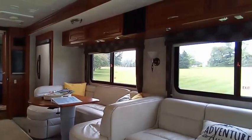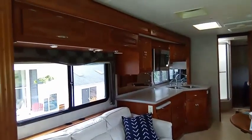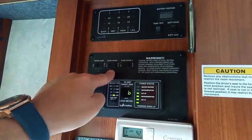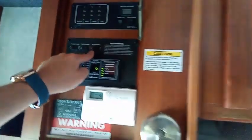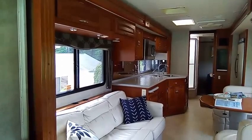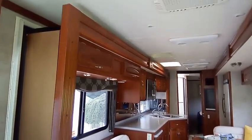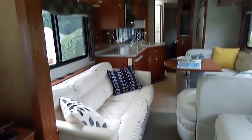Now we're going to pull the kitchen slide in and you'll see how it narrows — this will look the way it did when you picked it up. That slide button is right up here under slide room two. Slide room one doesn't do anything and never has. So slide room two is going to go in as well. We are once again double-checking that everything is out of the way, and in it goes. Just listening for it — making sure you don't hear any crunching or other issues. Once it stops, release the button. Slide one and slide two are in.